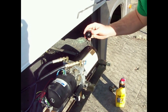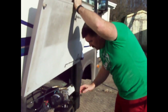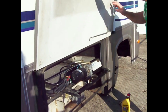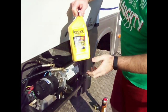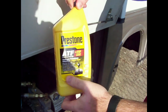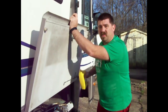Just as I suspected, it is pretty low. If you read on this pump, I can use a Dex 2 or Dex 3. All this is ATF fluid — automatic transmission fluid — and this covers Dex 3, so it'll be perfect for this application. I'm gonna go ahead and fill it up real quick and then we'll try it out.